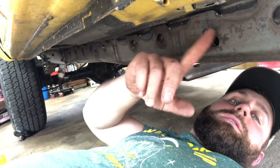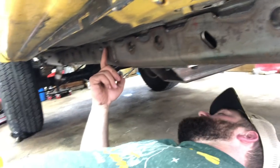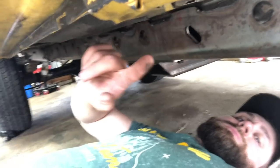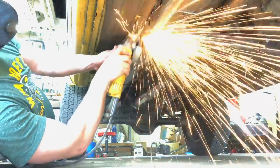Wrapping up your frame stiffeners — up to you — but I'm going to go across some of these welds with the grinder and a flap disc to clean up some of these welds just a little bit and some of the spatter. And then I'll hit these with some paint. I'm also going to power wash the inside as well as I can — it's going to be hard. And then a couple days later I'm going to use Eastwood internal frame coating to make sure I cover up any burned-off paint.